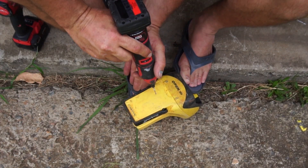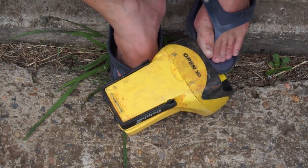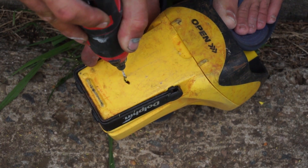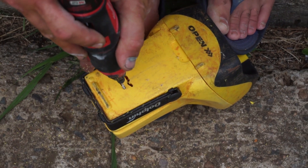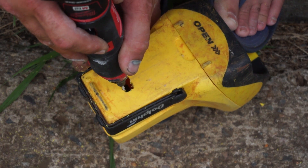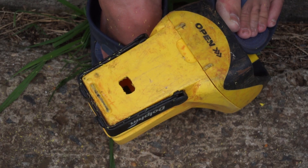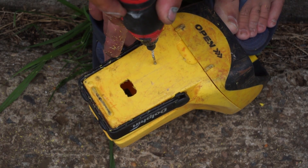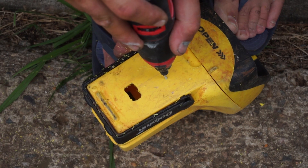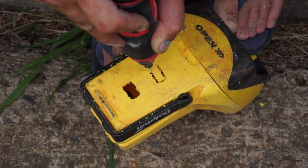Here we are now cutting plastic. This tool — try it first on high speed just to show how it melts the plastic, and then on the lower speed how it doesn't melt. Do another one next to it now with lower speed. These things are amazing — like if you're working on car dashes adding extra switches, bull bars, lockers, or whatever switch you need inside, it just cuts perfect.